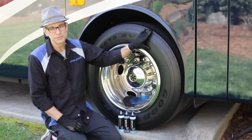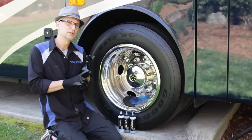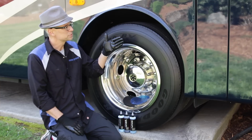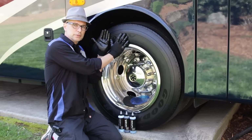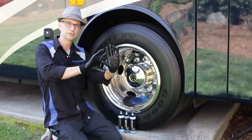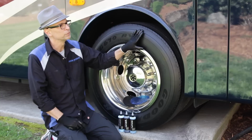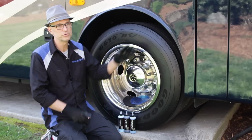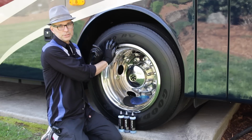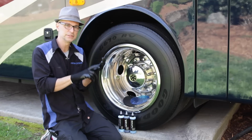Ozone. Tire manufacturers infuse all tires with typically a large amount of synthetic, some natural waxes, which migrate to the surface. As you drive, the pressure will bloom them out. You're pushing them out. It's called the blooming process, and those are what guard against the ozone. So when you clean a tire, you see this sort of yellowish orange haze on your tire that washes off. Looks a little brown, I would say. Those are actually your oxidized waxes.